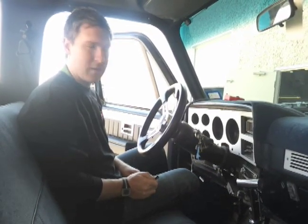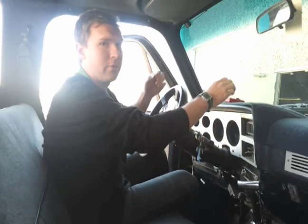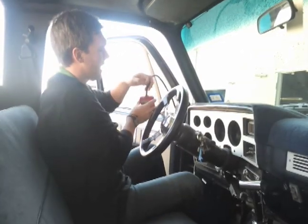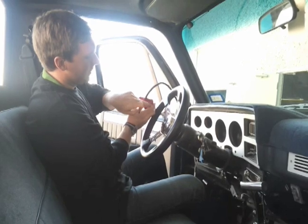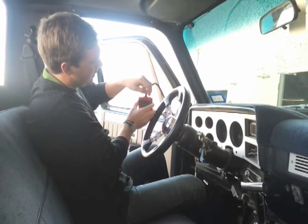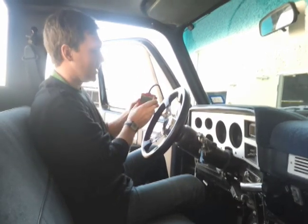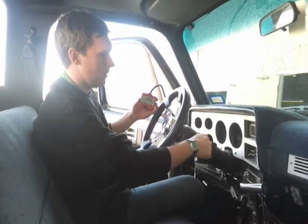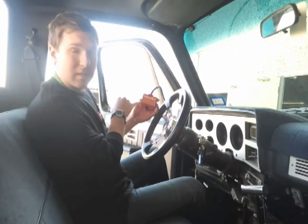We came outside to Chewy's '86 Chevy truck that just got an Atomic installed, and we're going to do the update now. Take your micro SD card out of the card reader, and in the top of the handheld you'll see a little slot. Just go right down in — it should pop in real easy and snap in. Then once it's in, key on without starting the engine, and immediately it goes into an update.